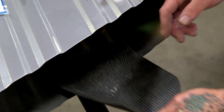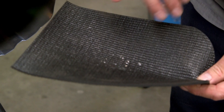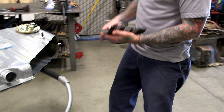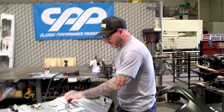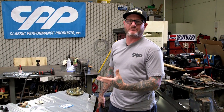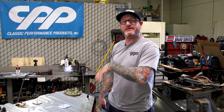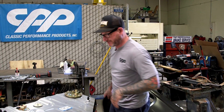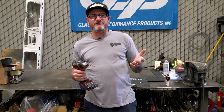That way you'll eliminate a lot of the chips from going inside the gas tank. I actually put something in here to gather how many chips would fall in there — it's actually very minimal as long as you're blowing that out, but you still want to try to get everything out. A lot of these chips are pretty large; they're probably not going to get sucked through your sock filter or your inline filter on the way to your carburetor or fuel injection. It's obvious our tank didn't have any fuel in it, but yours may.